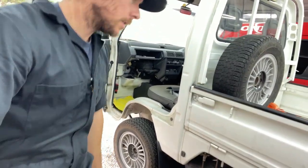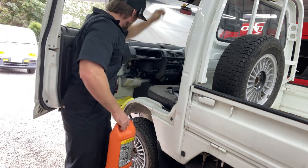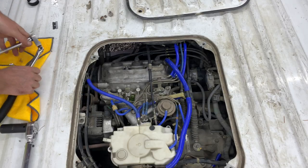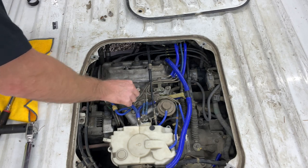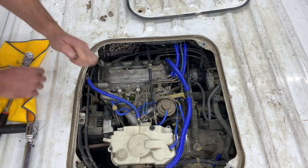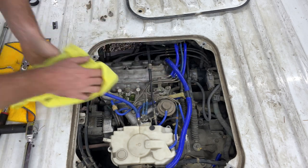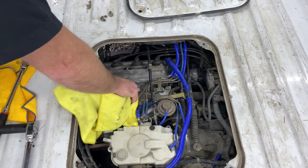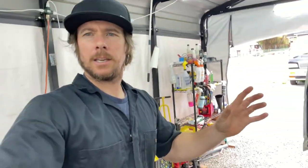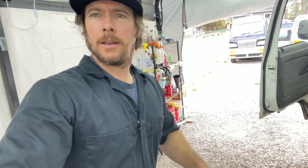Keep filling it up — we don't want coolant in the cab. The level is slowly going back down. Cracking the bleeder ports open again: coolant is coming out of both of them, so most of the air is probably out at this point. Now we're going to run it and try to soak the rest of the coolant up. Got those bleeders just tightened snug, so now we'll run it, turn the heater on, keep an eye on the temperature gauge, and add more coolant as we go.